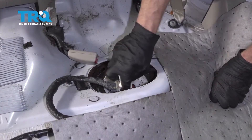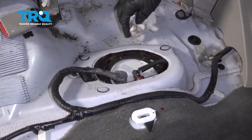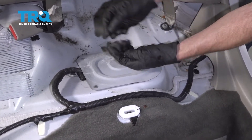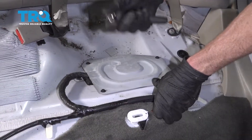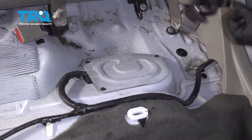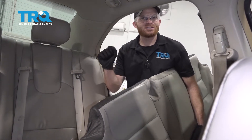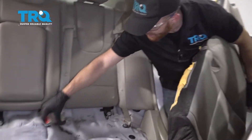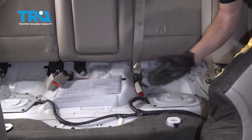Clean up your mess along here before putting the cover back on. Clean the body of the car where the seal on the plate is gonna ride. Go ahead and reinstall your plate — I like to start all of my bolts in before I tighten any of them. When snugging these up, I like to make sure I'm not using something electric that might cause a spark, since there will be fuel vapors in this area still. Now it's time to get the back seat back in. Before you do that, replace your gloves or wash your hands — you don't want any fuel getting on the back seat. As you slide the seat in, pay attention to all of your safety belts — make sure they're coming up and out from underneath the seat and not tucked in under it.